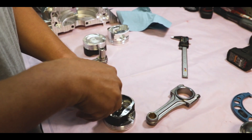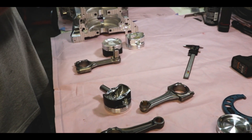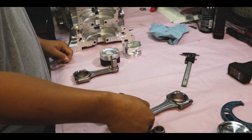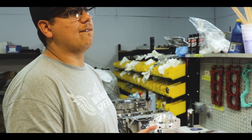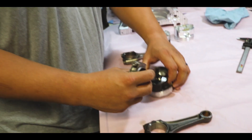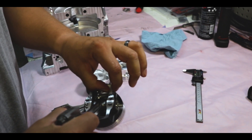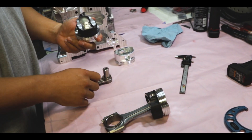These are the things we do to make this stuff stronger. We've been playing with turbocharged stuff for a long time and we kind of know what happens first. We did this and still had some pin bushing getting blown out — we were just at the limit, talking north of 50 pounds of boost. We found the pin would still flex and flex the piston, so we added a lot of strut width to prevent cracking. The next revision was going up to a 20 millimeter wrist pin.